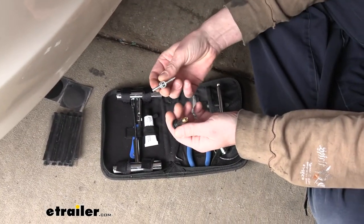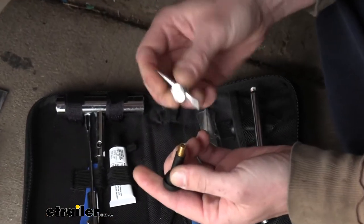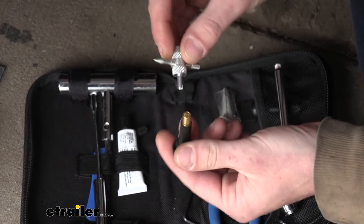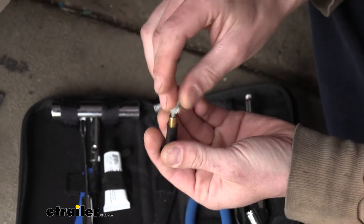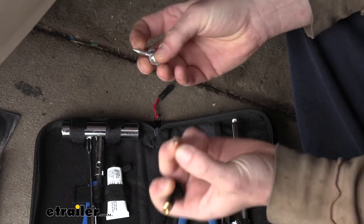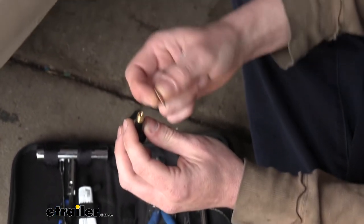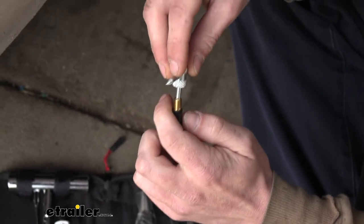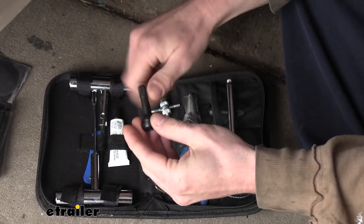There are a couple of other sides to this tool — sides that can be used for pushing in to release some air, in a couple different shapes. And this is our valve core remover: you put it on there and twist the valve core out. If you had this in a tire under pressure, keep some pressure on this and be ready because it's going to want to shoot that little valve core out. You can actually swap the valve core from the one in your kit over to the one on your tire, because the little red seal on the stem on your vehicle could be damaged and leaking. Since we don't have a leak there on ours, we'll just put this back together.